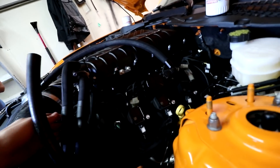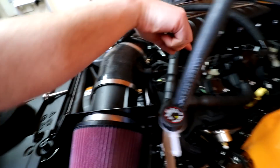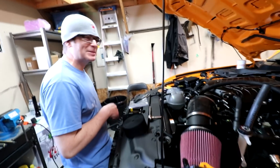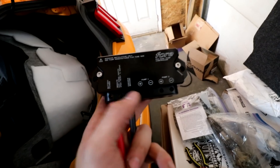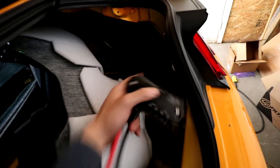Didn't you buy the thing that goes in the cab? Yeah, this hose right here — you actually got to drill through and put it through the cab, but I'm not worrying about that to get this thing started. It's a sound tube to the intake into the firewall so you can hear the Whipple on the inside of the car. It's a ricer tube. So they actually give you this neat little distribution block for the fuel pumps — we got a main power wire going up to the front on the ground, and this goes to pump one, pump two, and then your original factory pump leads into here to switch both pumps on. We're just gonna mount it back here in the trunk, out of the way.